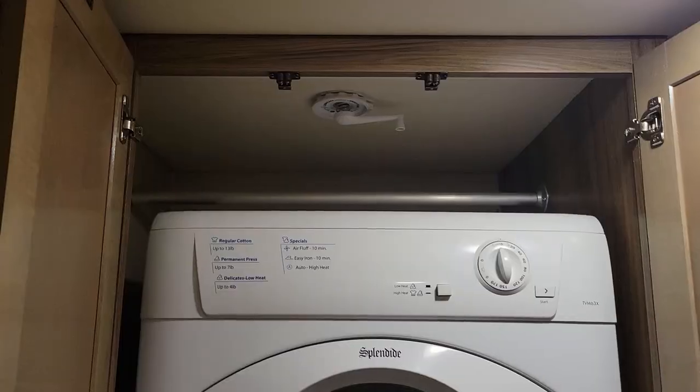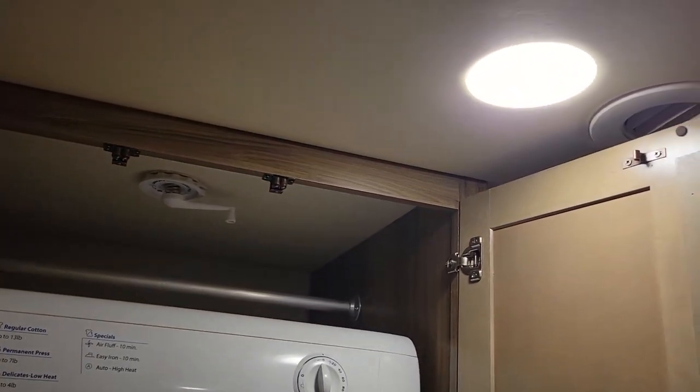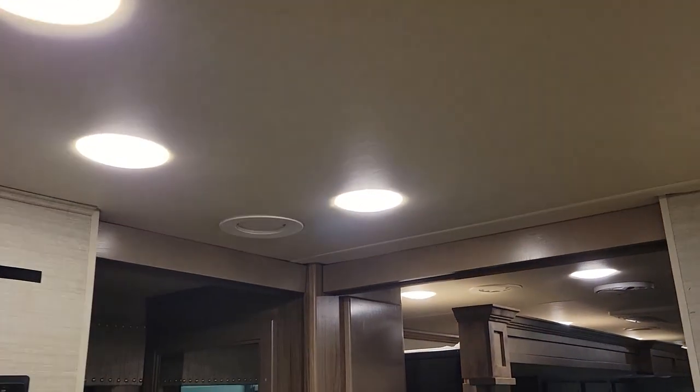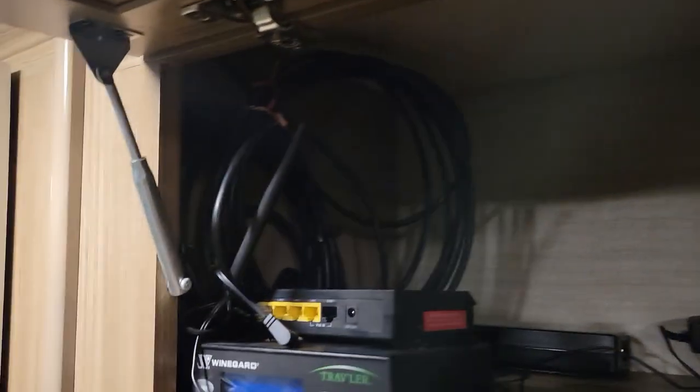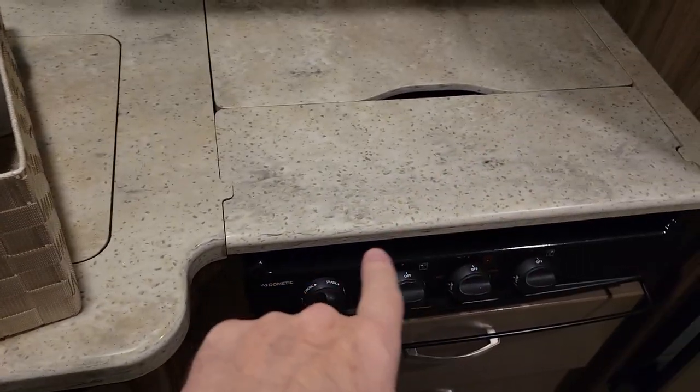Going inside - the antenna is located in the very back of the RV. The cable on the roof I'm going to run alongside the air conditioner and probably along the solar panels, and it's going to come along to above the microwave. Above the microwave I already have a hole that goes up to the roof with a ceiling plate on top with room for more cables - that's where my Traveler dish and Wi-Fi booster cables are. I'll mount the booster in here, then run the inside cable down along the refrigerator, under the stove, behind the sink.